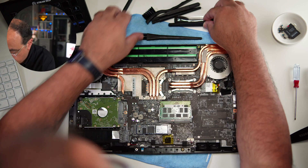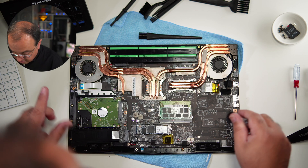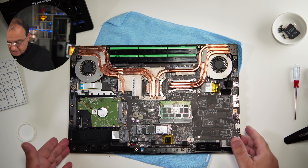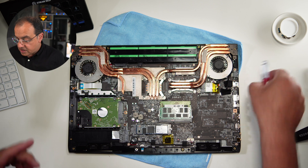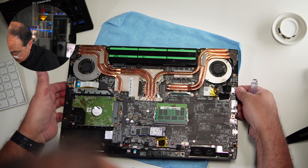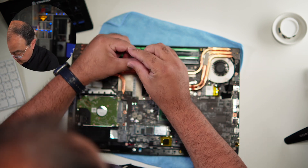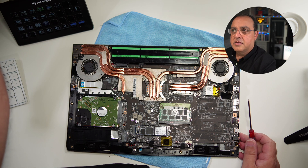So that's the battery — let's move that out of the way. Don't have it plugged in, and try not to touch anything with your hands. This has been unplugged and run flat for a couple of days. What you don't want is to get a shock from any residual power on the components — so avoid touching them, unplug it, and make sure your battery is totally discharged.